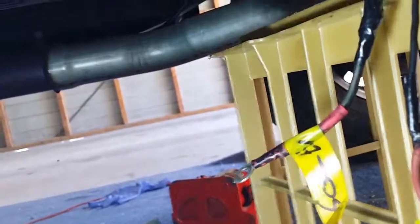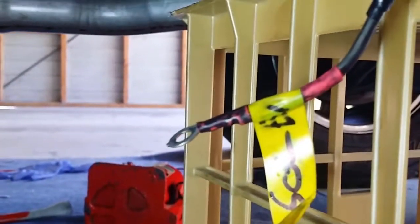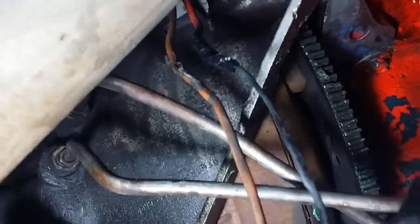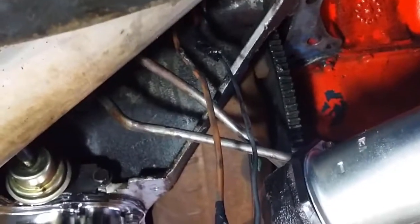Okay, so the battery cable, the one closest to us, that's the thick red cable coming from the cab. So that comes down, and that's the battery cable. The other one's the power supply to trigger the solenoid, and that joins up, I think, the top one there. So that's the brown cable. That's that one there, and it's also got an exposed wire up the top there. So they're the original cables up the top there, and we're looking up at the firewall, and you know, that's a pretty nifty piece of work if you ask me.